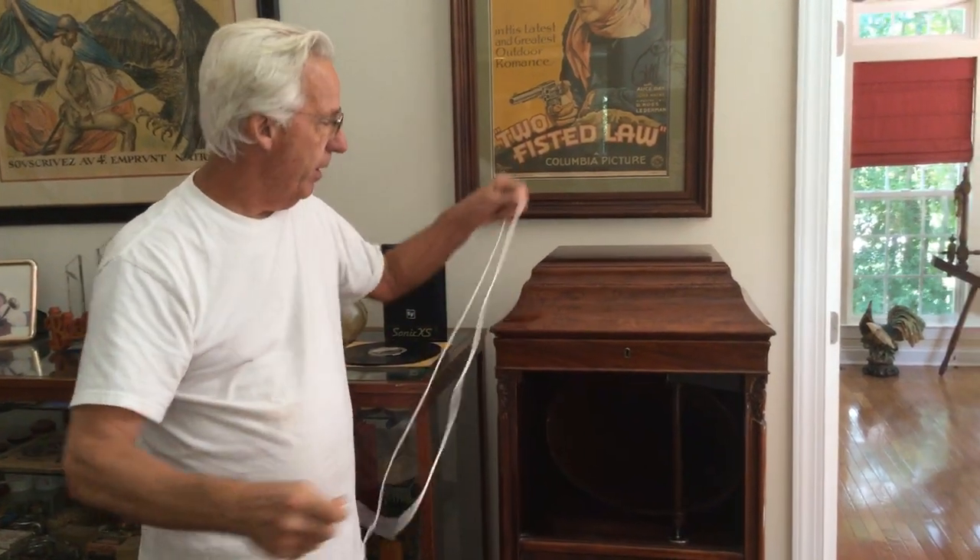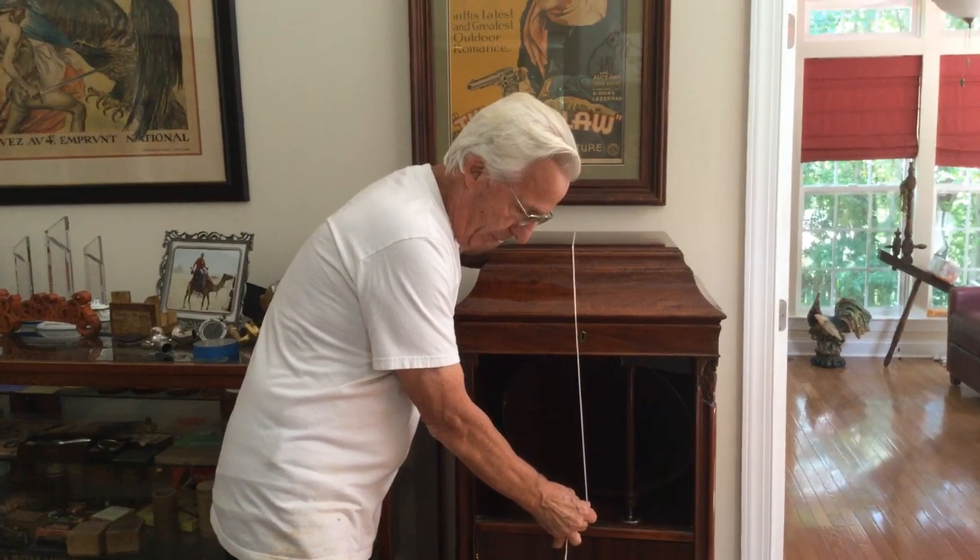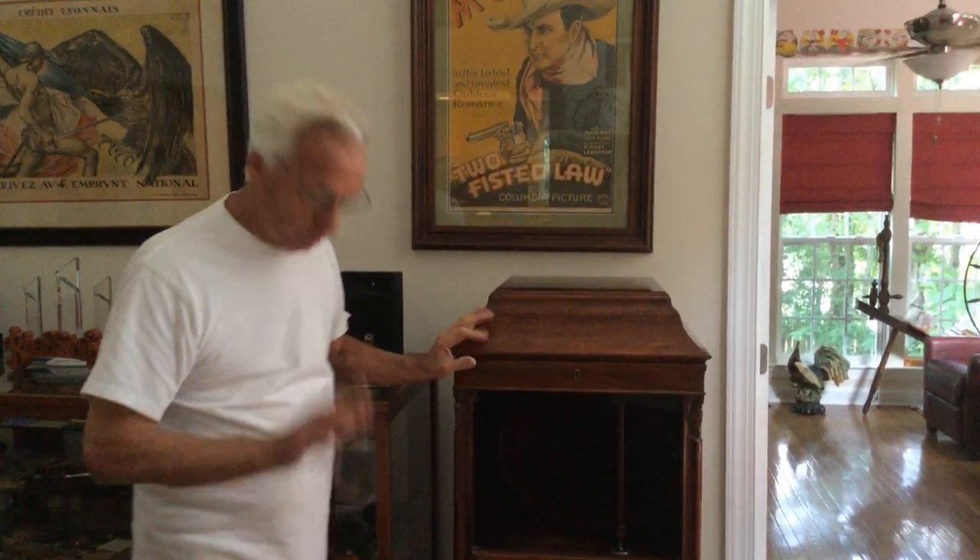Next, cover it with a packing blanket or some material you have. Then take a piece of string and run it around the machine and tie it down. You want the lid down because when you lay the phonograph on its back to put it in the back of an SUV or pickup truck, the lid is going to open. If you ever transport one standing up in a pickup truck, you want the lid where it closes facing the tailgate — otherwise going down the road at 60 or 70 miles an hour, the lid will come up and go flying off your phonograph. So wrap it, then tie it down.